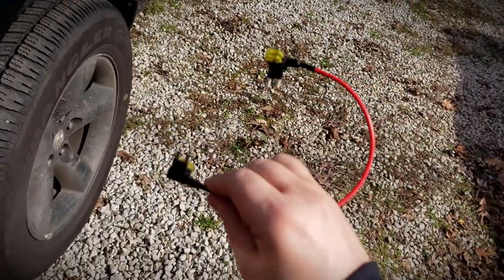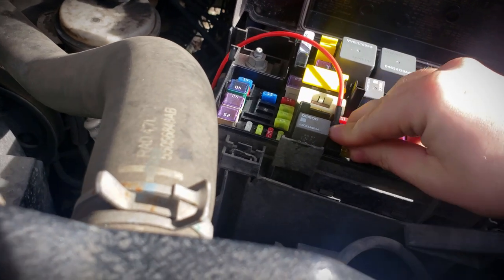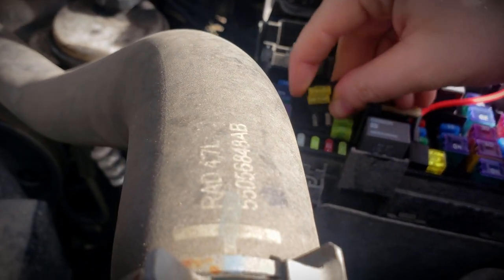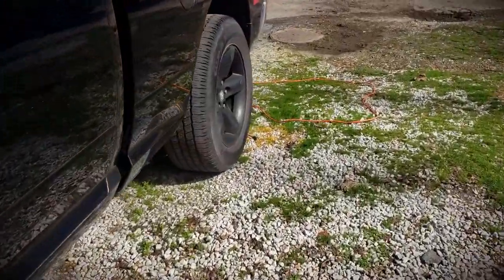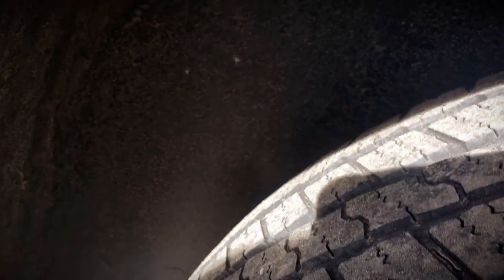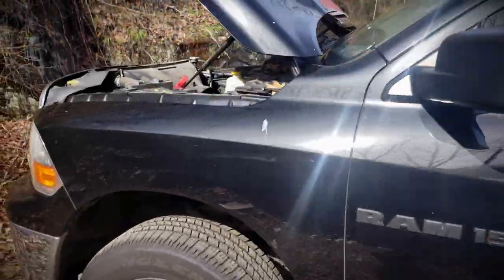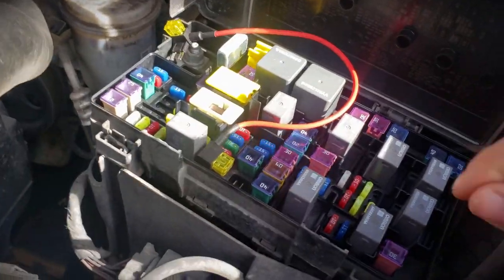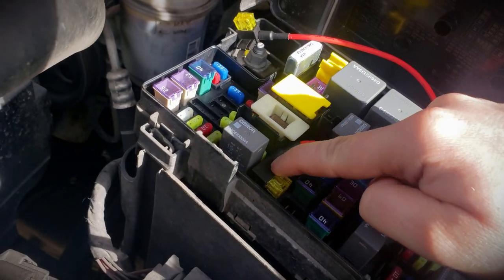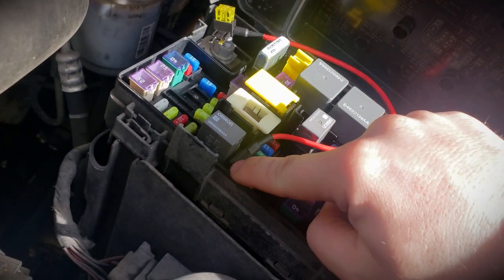But for $16 this will get us back on the road. To test the fuel pump, you plug one end of this cable into your M25 slot and then bring it around to the right two terminals of your M7, which is the rear cigarette lighter. Once you plug those in, if you come to the back you can hear the fuel pump pumping. That will not hurt your truck from what I've understood — do not hold me to that — but that is a way to test the fuel pump to make sure it is working. The fuel pump relay itself is the prong that's furthest away from you.